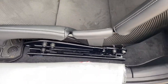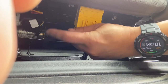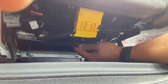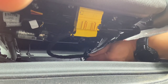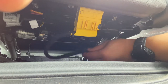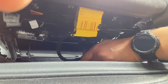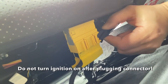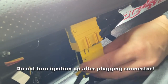Centering the seat just gives us more room to maneuver it out. Now under the seat, we need to disconnect the yellow connector. First, follow the loom halfway through and pop this plastic clip off, then undo the yellow connector so the seat won't be held by the cable loom when we pull it out. The yellow connector releases by simply pulling the black tab — as you pull the black tab away, the connector will back out.